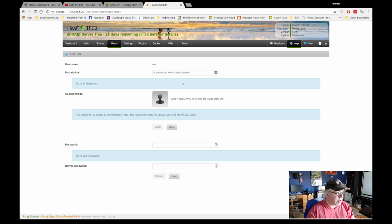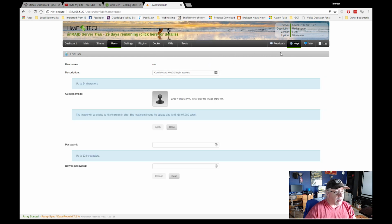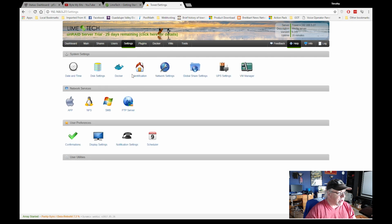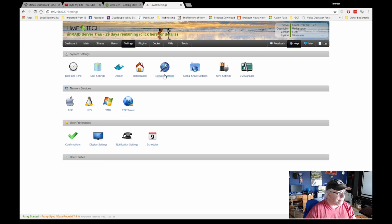I need to set a root password, so I'm going to do that. Let me give it a password. Click on change. All right. So that let me in. So let's go over here to settings. I want to make sure our date and time are set correctly. NTP, yes. Okay, we come back here to identification. That's the name of the server. We can leave that. Let's see, network settings.